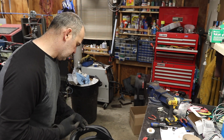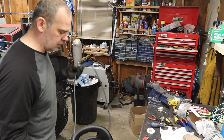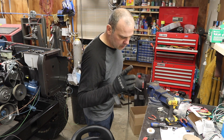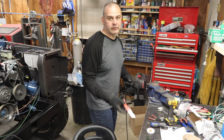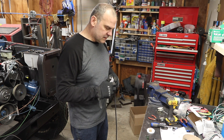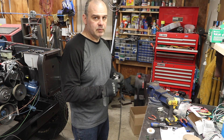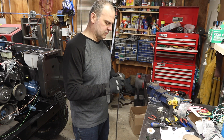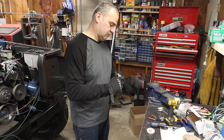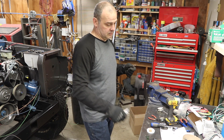The cable I'm using is EWCS welding cable, but it's got 600 volts, handles high temperature, and it's made in the USA. I think I got it on Amazon. What I really like about it is it's oil resistant — not all welding cable is oil resistant, but this one is. This is advertised on Amazon as 4 gauge, but if you read the comments everyone says it's actually 6 gauge, so I just listened to the comments instead of buying the listed size.